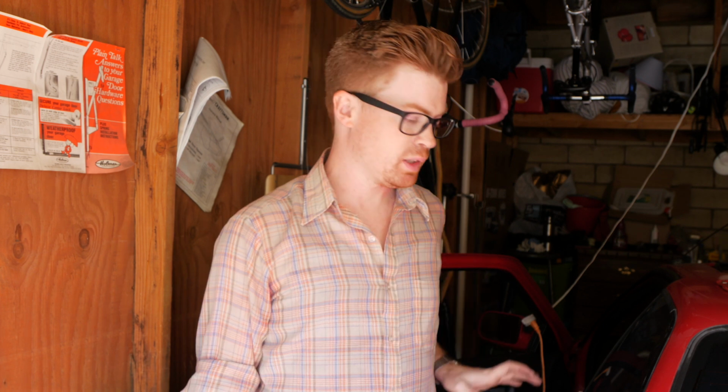Okay, so there we go. We got our seatbelt reinstalled and it's working quite a bit better. Some notes that I would say, you could probably go a little bit tighter on the flat spring than I did, and I think that'll give you a little bit better performance. Also, make sure that you slide all of the fittings back onto the belt before you try and reinstall it. Some of those plastic pieces need to go back onto the belt before you put it back together.